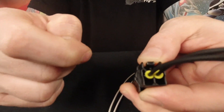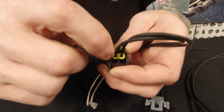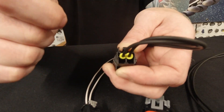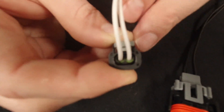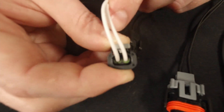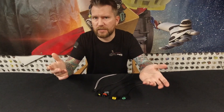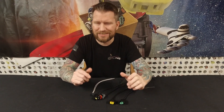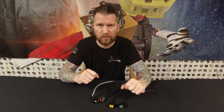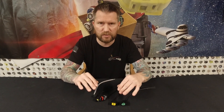On our seals on the back, water tightness is important. When it's in, it's going to be snug. As that seal goes in, it kind of pushes it down — these are longer seals, so part of it sticks out. When you put the wire in, you can tell that the seal is compressed, and that just helps with watertightness. You don't want water getting in when driving through high water, washing your vehicle, or when water splashes up into your engine bay. The worst thing that can happen — and it does happen with cheaper connectors — is water penetrates through the back of that connector and will short out stuff. Especially with cars nowadays with sensitive computers, if the engine bay gets washed down, it can throw lots of codes and cause lots of problems.